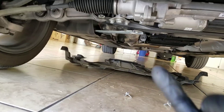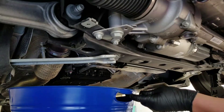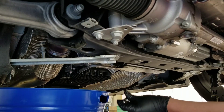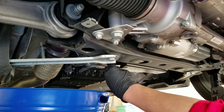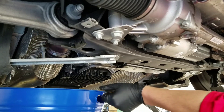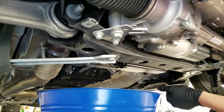Back pan — so between both of them it's about 15 bolts, and way back here is your motor oil drain right there. We just got done letting her idle for 15 minutes. We got our 13 millimeter socket, got her cracked loose, and now all we do is just drain her down.